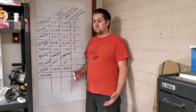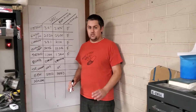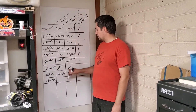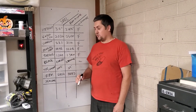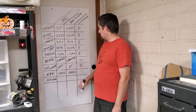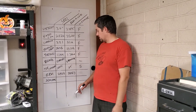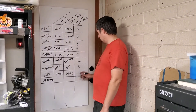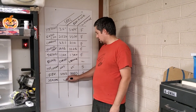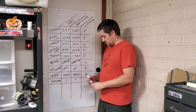Blade design — curved versus straight — I don't know that that matters so much. Curved blades can tend to be a little quieter, but I didn't notice a difference in noise level between the two fans, so I'll call that a tie. Tip clearance — we talked about that in the design portion — much tighter tip clearance on the Spall fan; that checks the design geek box for me, so I'll give that one to the Spall fan. RPM: the Spall fan ran at a higher RPM — 2,904 RPM on average across 100%, 50%, and 0% blockage — while the Flexalite ran at 2,223 RPM. Win for the Spall fan. Sealing: the Spall fan looks to be a sealed motor, whereas the Flexalite does not — win for the Spall fan.